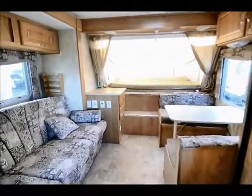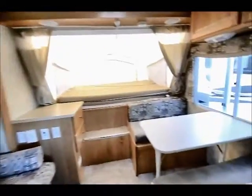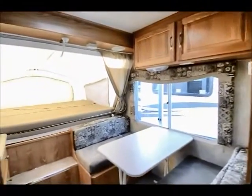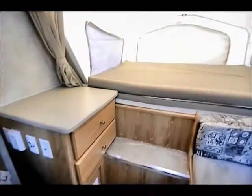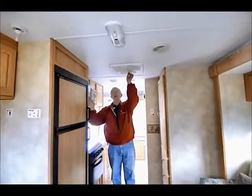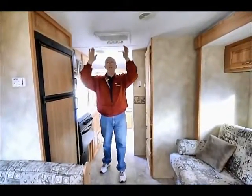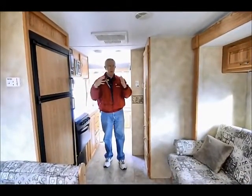You have the sofa that's slid out right now, you have the dinette on the opposing side, plus you have a full bed in the front — and as I mentioned, that whole bed will fold up very, very compact. Up above here I have my ducted air conditioning, and this has what they call a quick air dump. In other words, if I come into my trailer and it's very hot, instead of waiting for air to go through the ductwork I can have all that cold air dumped right in here and cool it down a lot quicker.